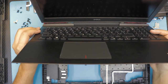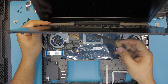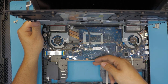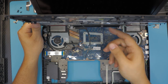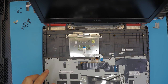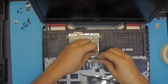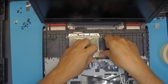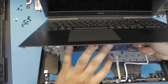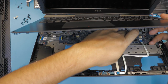We're going to slide the top end where the heat sink goes and put the cable for the power button, then slide down the flex cable for the screen. Make sure these two cables go right over here to the other end from outside so they don't stay underneath. A cool trick: grab some tape and tape these cables all the way back. Now I've got the keyboard and on/off switch button connected.